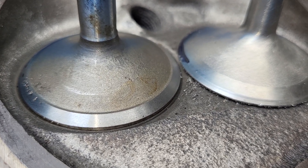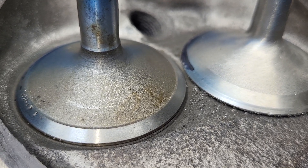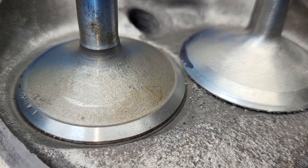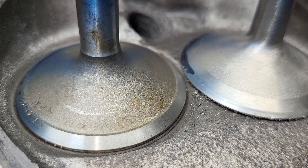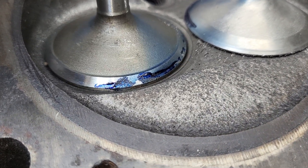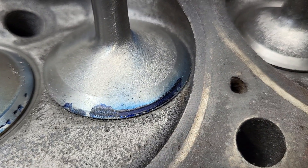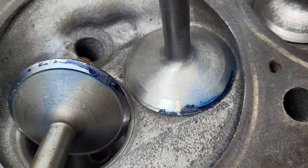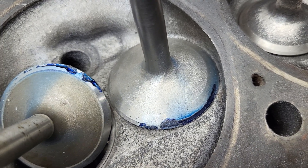It still has a small evaporation ridge on there, and I wanted to see what it's going to do as far as our gross flow numbers and how it handles the liquid, because stock engines have an evaporation ridge on that valve — like we saw on the throttle body injection, sometimes inside the bowl, to aid in breaking up those fuel droplets. See how that evaporation ridge really gives it a kick as the liquid's coming over it?